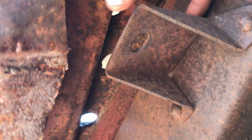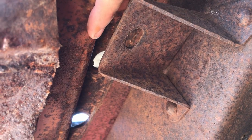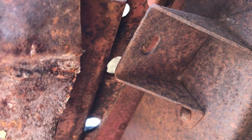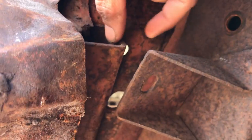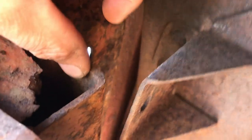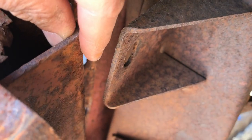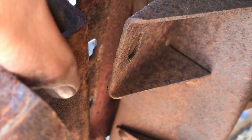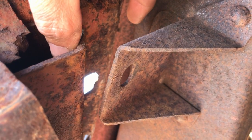Now, if I was to attach a 2.5-inch rubber bushing here, it's going to interfere with this. Now, if only they had installed this over there, everything would be fine, but it's not. So I'm thinking I'll probably extend this beam over to there, and that will give me that much space. I'm going to raise it by maybe an inch altogether, so this just needs to come up 1/2 inch to put the bushing in there once I extend this beam out a bit. So that's fun.